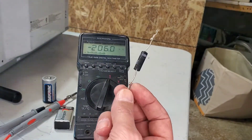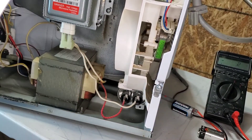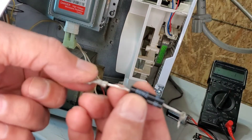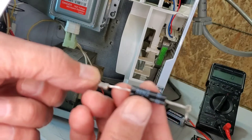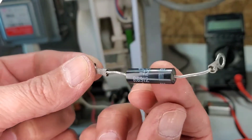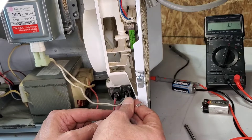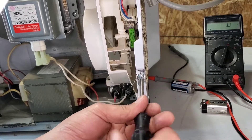That's how you test a high voltage diode. I found out what was causing the microwave's no-heat problem — it's just because of this diode. Unfortunately, I looked at other parts and could not find a similar one locally. This diode has a part number: RG9612. I'm going to order the same one and as soon as I get it, I'll put it back and test the microwave again. I know the number, so I'll order it and hopefully it won't take long.